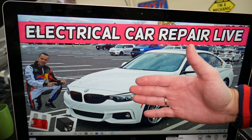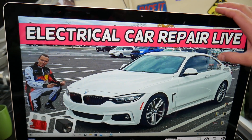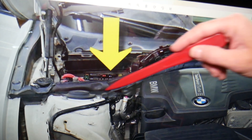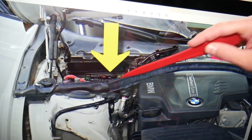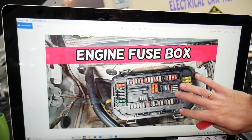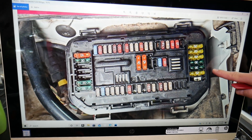We have up to three different main fuse boxes and three secondary fuse boxes in this car. Today we need the main fuse box under the hood. Open the hood right in front of the windshield on the passenger side and behind the shock tower. You have one trim cover — remove it. You get to a fuse box, and once you open it, you will see that layout right here.